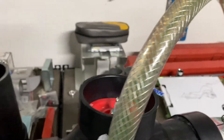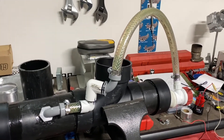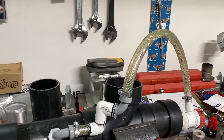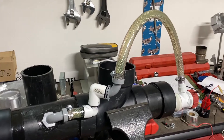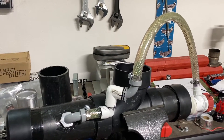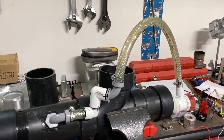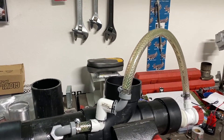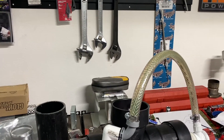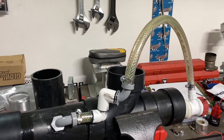My plan is for the wintertime — no problem, the air-to-water intercooler not circulating right now but I'd rather have it circulating. Summertime, I'm going to have a radiator-type system with an electric fan. There's no way I'm going to be packing this with ice in the morning and then after work every day just to get the intake air temps down. So for the summertime — winter is just starting here — I have time, so I'm going to wait on that setup and get this setup in.